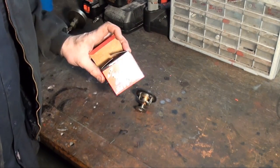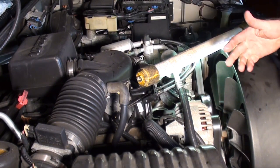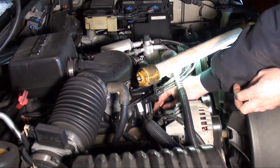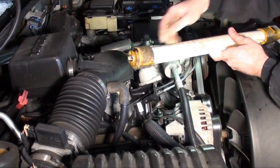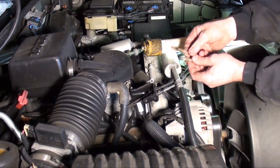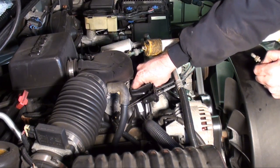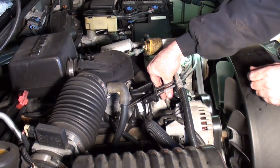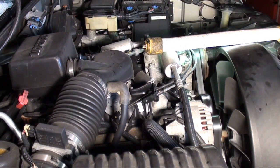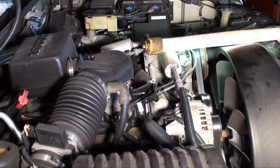Let's prove this theory and install the new thermostat. Just to make sure everything is clean — and as you can see, the whole gasket slash O-ring was replaced with the thermostat, so it came out as one assembly. I'm going to install the new one just like so. You can then install the thermostat housing. There are two studs — this one is all rusty, this one is clean, so this is the one that had the nut on it. I'm putting it back the same way, running it down snug with the impact, then tightening it with my ratchet.